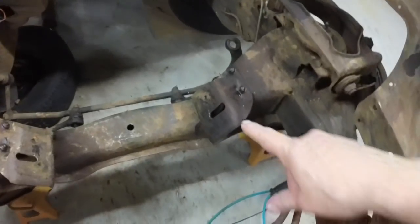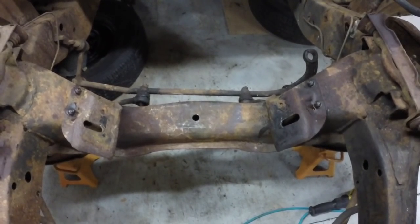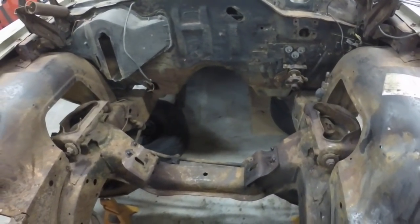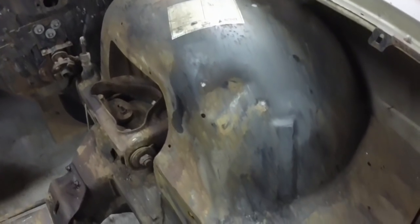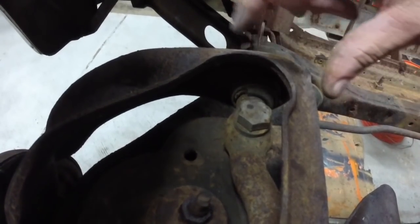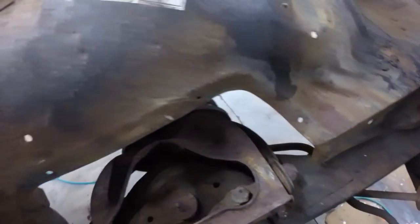I just took the shift stuff off. I'm kind of running out of time — I've got other commitments this evening, so I've got to wrap it up. I surprisingly got a lot done — worked on it for maybe three hours and got the wiring harnesses, wiper motor, brake booster, shift linkage, and all this rubbery plastic stuff off. I also got to weld those two holes shut. You can see how the rubber is starting to come apart — if I don't replace it, the control arm will move on this and the car will drive very poorly, all over the road. So we're going to put control arm bushings in it.